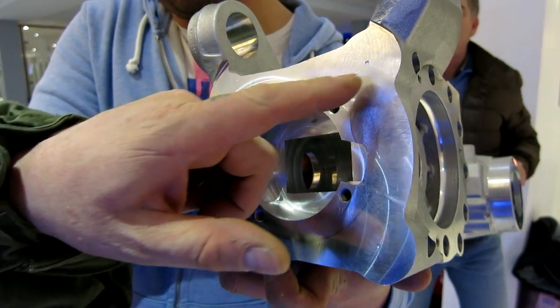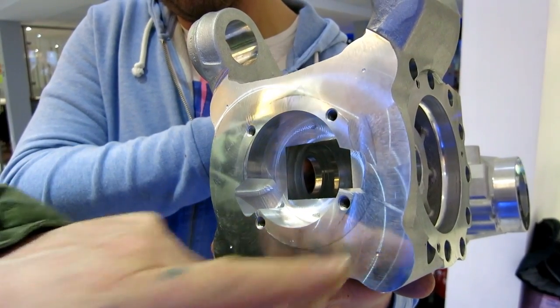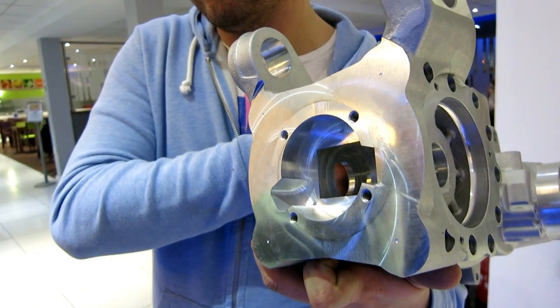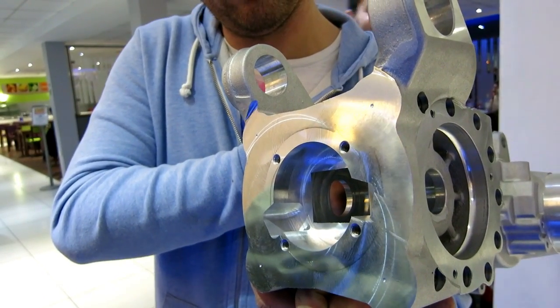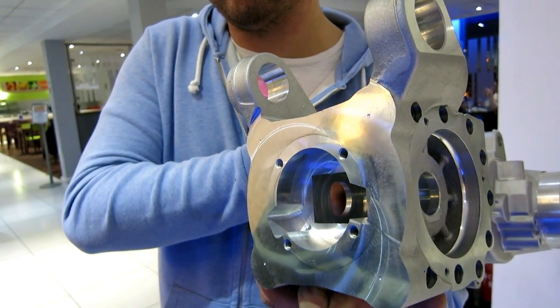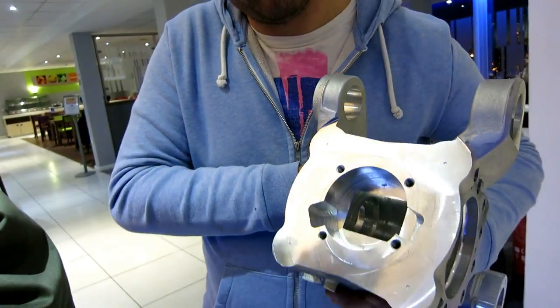The four indentations on the outside are where the new barrels will be fitted. These are external studs, and there'll be air-cooled and liquid-cooled versions in various strokes, cranks, and sizes. Basically this will take anything currently available on the market, including the 305 barrel if needed.